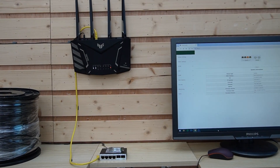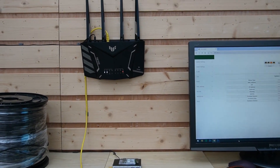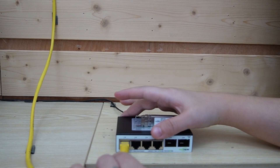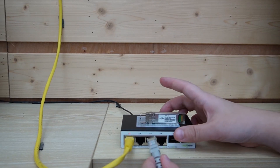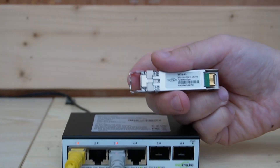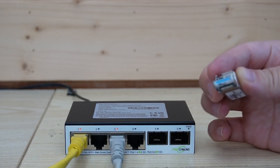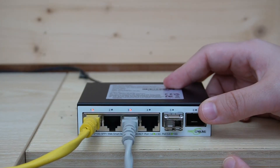So now let's get into the fun part — setting this up. Here's a step-by-step guide for installing your 10G media converter. Here we have a router. I'm going to use an ethernet cable to connect it to our 10G media converter, and then another ethernet cable to connect the converter to our 2.5G computer. Now I'll take the LC single mode fiber 10G SFP plus module and insert it into the SFP plus port on the media converter — and it clicks right in, just like this.